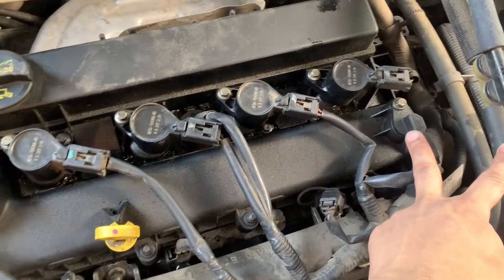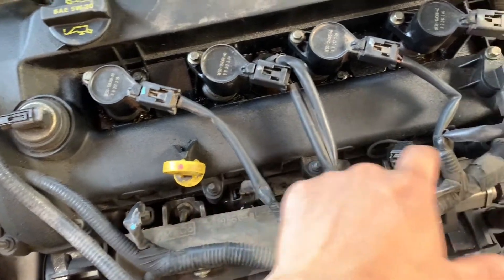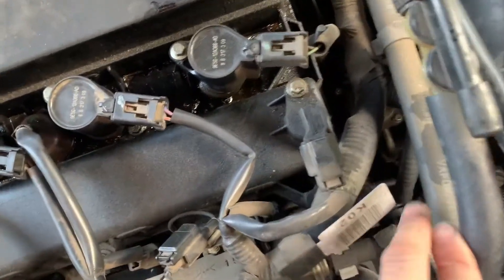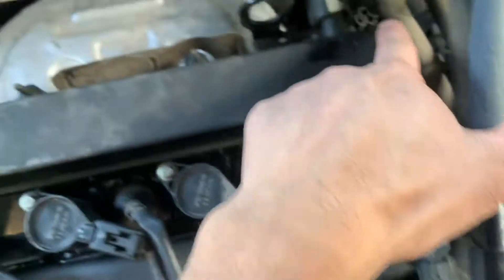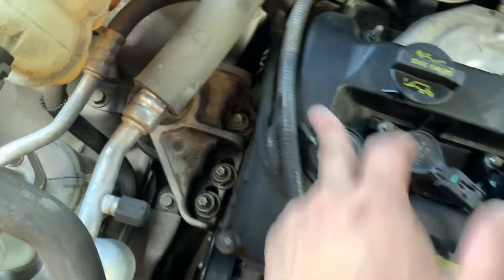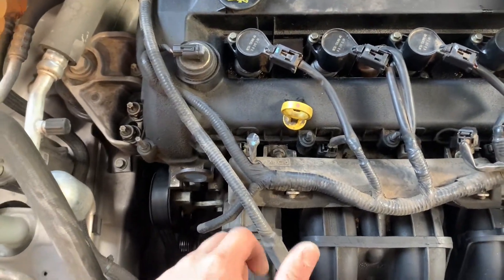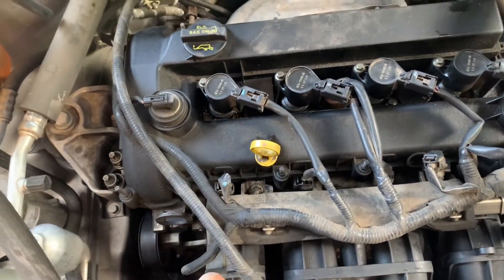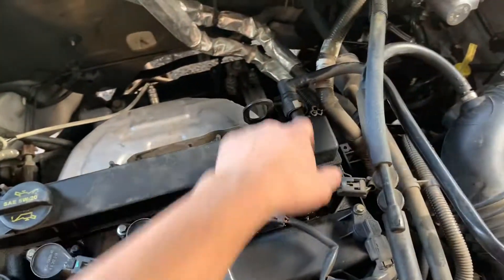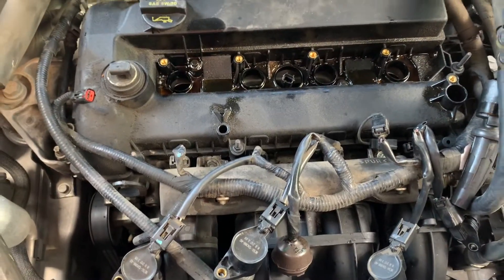the sensor here. There's a total of — one, two, three, four, five, I believe there's one under here — six, seven, eight, nine, ten, eleven, twelve — number eight millimeter bolts. Using an eight millimeter socket, we remove all that. Pretty much it's getting anything out of the way that obstructs removing it, so go ahead and take that out.